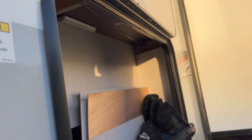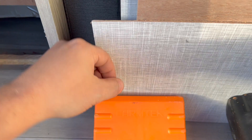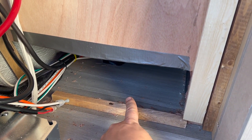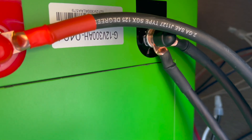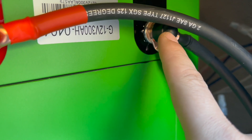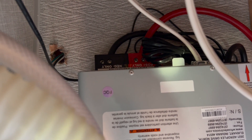The thick negative wire is connected to the frame and routes through the trailer into the inverter. I unscrewed the inverter and brought it out so I could work on it. This small inverter has a red wire and a black wire — I removed that black wire and sent it through the pass-through to the other side of the trailer and connected it to the battery. Then I got another black wire, connected it to the battery, snuck it all the way through the pass-through, and reattached it to the negative end of the inverter. The inverter now has a negative connection from the battery, so I remounted it.